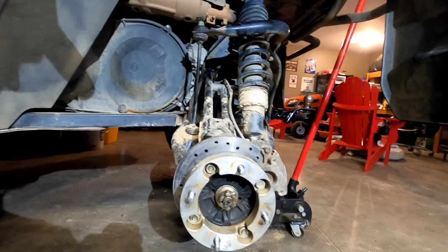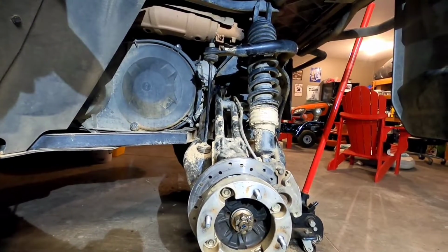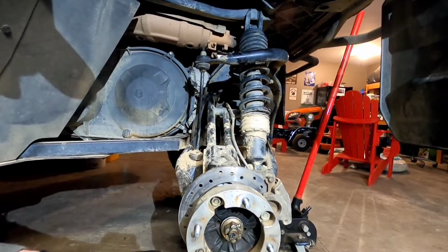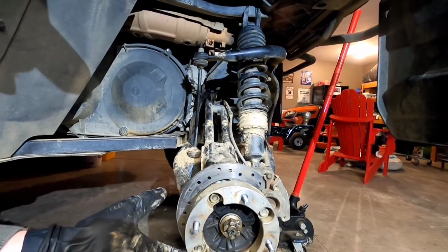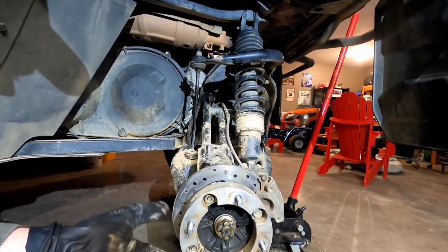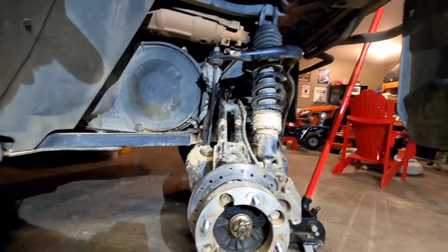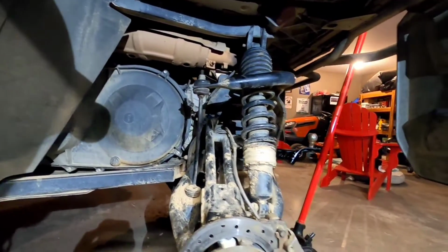As far as the torque spec, I know I mentioned in the video to call the dealer and find out for sure, because I think every bike is different. There's quite a bit of discrepancy online about torque specs with these bikes. Some say 150, some say 160, 166. So I think what I'll do, I'll just grab the torque wrench and I'll put them at 150 and leave them there until I find out different.